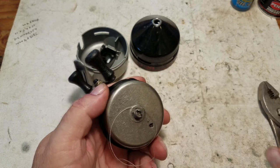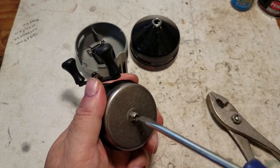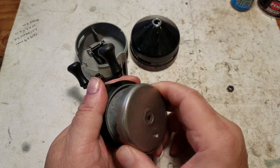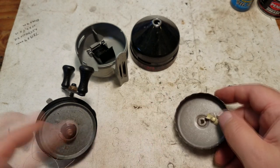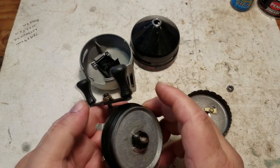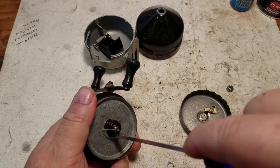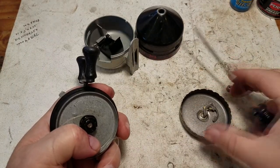To take this off you can use a pair of pliers or a big screwdriver. Get that loosened up and take that nut off — there's a little D-shaped bolt and pin in a D-shaped hole. Take that off. This is the cocking mechanism that goes in place when you push the button, and there's a little cam system that pushes it out of the way as it rides around.